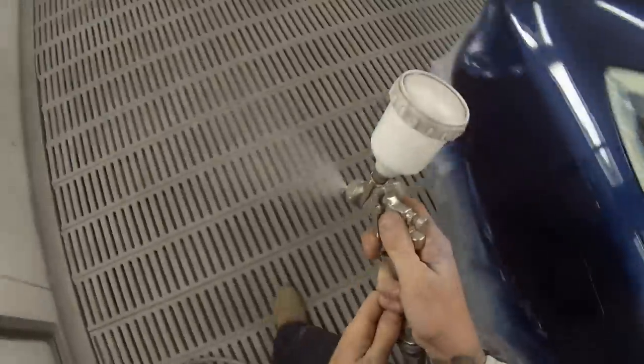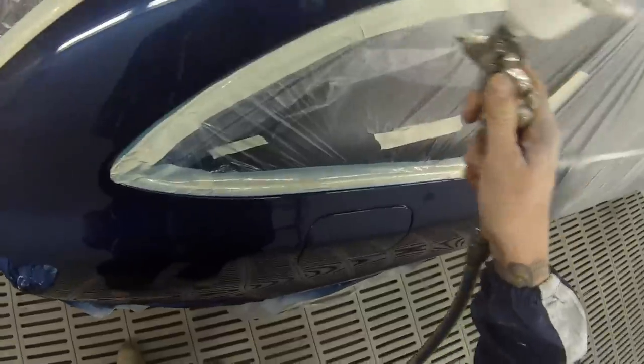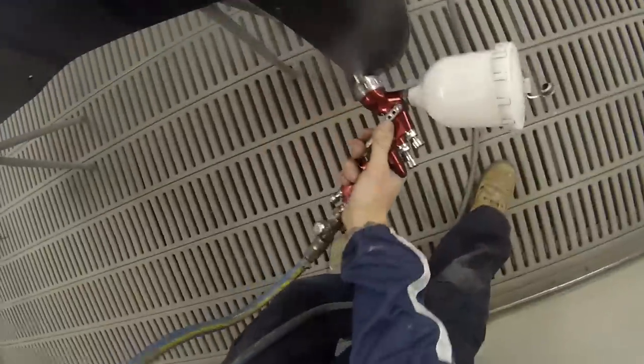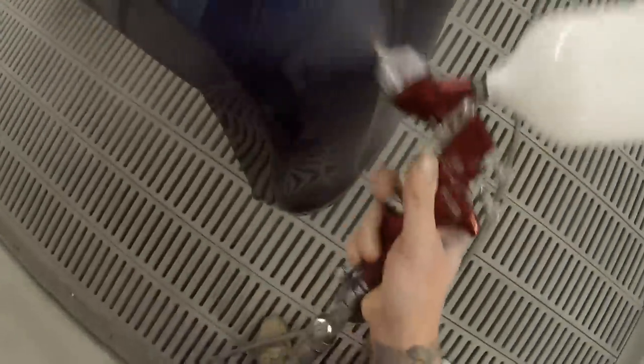So that was our second coat of clear on the quarter panel. We've then decided to blend this clear in, so I'm just putting some blending reducer — which I've actually got in this separate mini-gun — over the edge. We'll then go for our second coat of clear on the bumper bar right now. Same settings as the first coat. Do all the edges first — I find it's the best way to do the bars — start at the bottom, then do one side, back to the centre, then over to the other side.